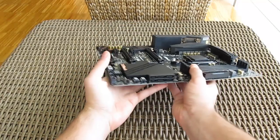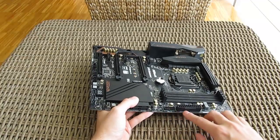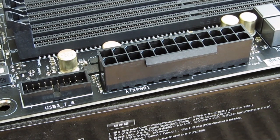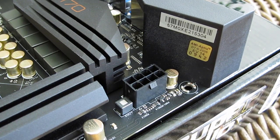The rest of the SATA configuration consists of 4 SATA ports combined into two SATA Express ports, and next to them on that right outer edge of the motherboard you will also see a USB 3 header and the 24-pin ATX power connector, while the 8-pin EPS power connector is well hidden in the top left corner between the armor shield for the IO and the passive heatsink for the power circuitry.